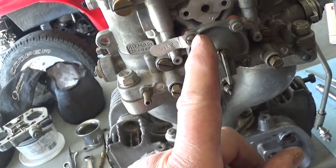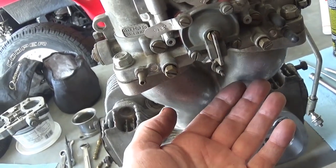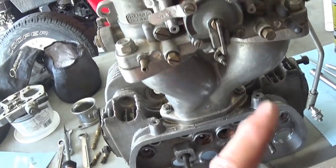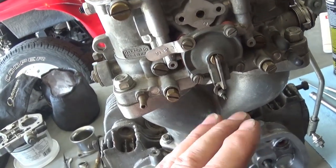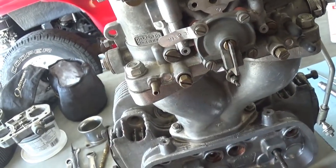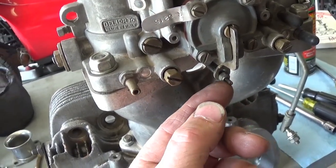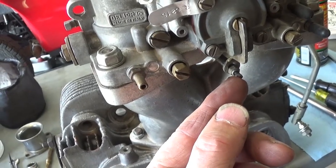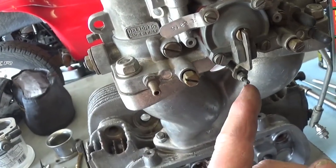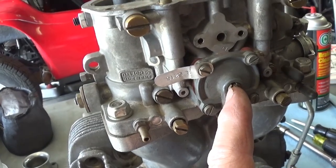And so you take these screws out, and be sure if you're doing this out in the road or on the dunes that you put a tarp or something down on the ground. It's not that far down. And if you drop any of these screws or washers and stuff, it's not going to disappear. This distance on this accelerator pump screw is telling me that there's a lot of squirt going into those cylinders. The farther out it is, the less it activates the diaphragm.